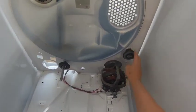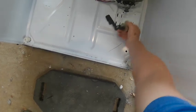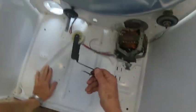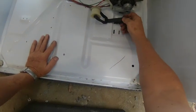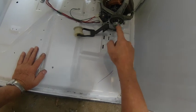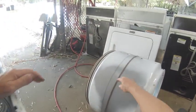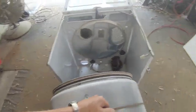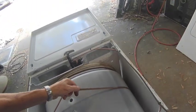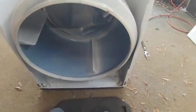Let me put the tools away before I reassemble — I'm going to blow all this out and clean it up, make sure there's no dirt in it. There, it looks brand new. The idler pulley has this little angle on it with these little feet — put it in the slot in line with your motor pulley, going up just like that. Then take your tub, put it in, and set it on top of the rollers.